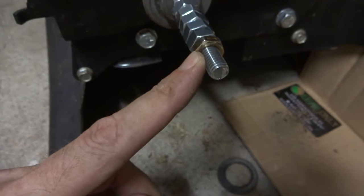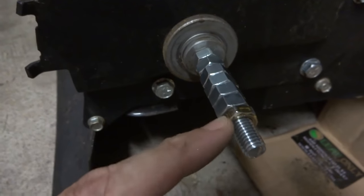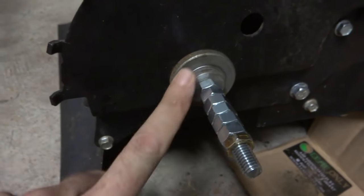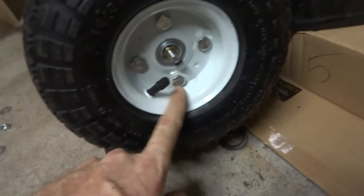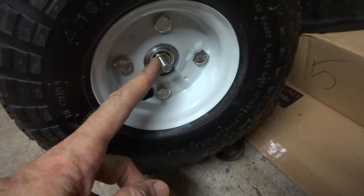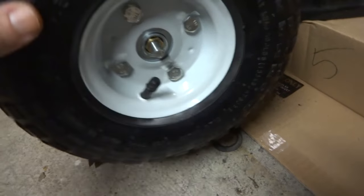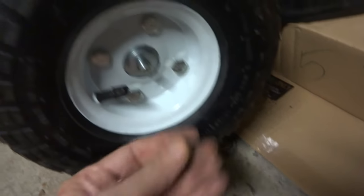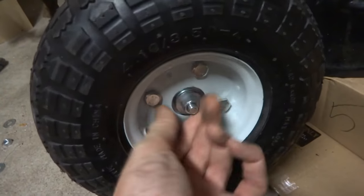This one's a bit shorter, that's why I use that one. So it's one, two, three, four, five, six, and then the bolt that you already have — this is a three-eighths by three and a half inch bolt. Put that piece back on there and there you go. Now put the wheel back in — this is a five-eighths diameter hole. Or if you've got a shop, you can cut some tube and make a custom spacer tube; either way will work.